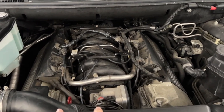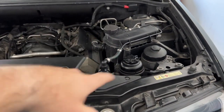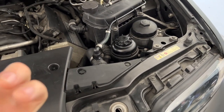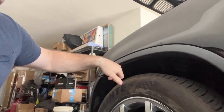So I did some research and apparently it comes down to your heater water cycle. This is the 4.4 E53, the 2003. You have your valves here and the auxiliary water pump is down there. What happens is if the heater is on, it wants to circulate warm water from the engine through the heater valves, back to the heater, so you have warm air inside. But if this pump is broken or dead, it will just take so much energy to start that it pops the fuse. Once I disconnected the pump, it wouldn't pop anymore — since then the climate control is working fine. Pump is done.